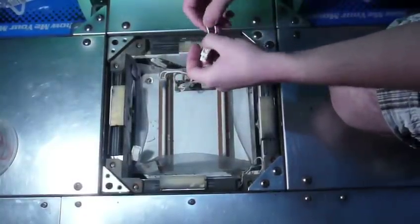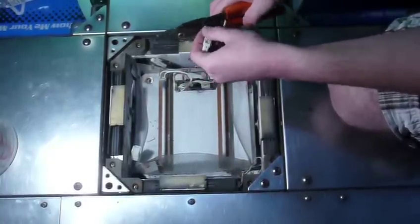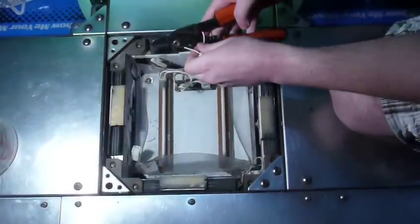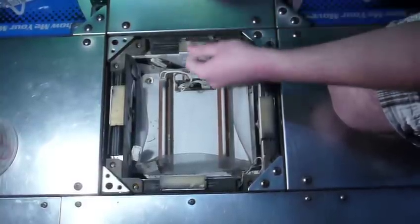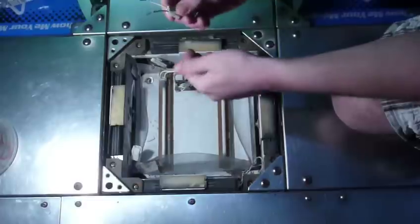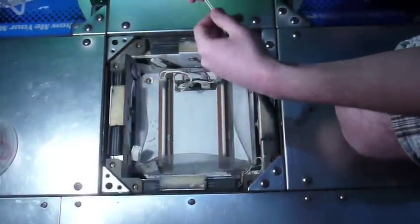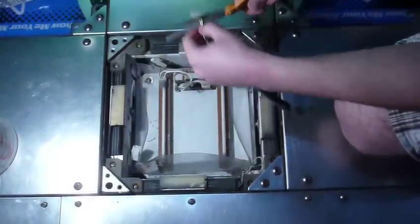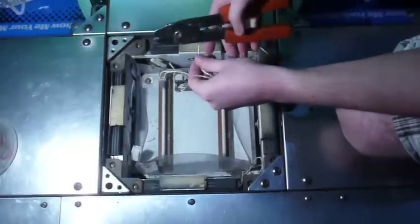What we're going to do is take off the casing of the wire. So we're going to put this in like here, and we're just going to pull away the outside of the little connector. Okay, now we're going to do the other side. Alright, there we go. Now we have a little bit of room to work with. Our wires are exposed. So now we can do the same thing to the Pump It Up sensor. Okay, so here's our Pump It Up sensor. Go ahead and cut away this connector here, and we can cut away near the top of this. So we're going to be using the bottom portion of the sensor. Go ahead and cut away the casing for the wire.